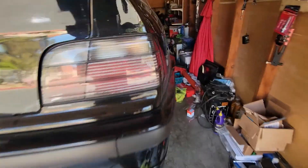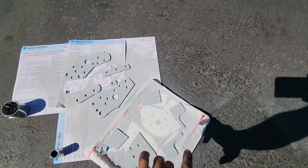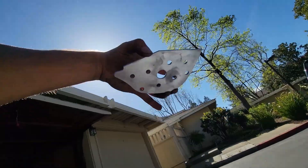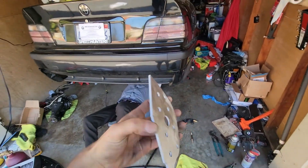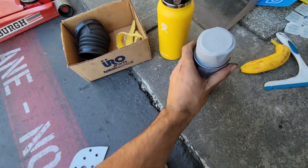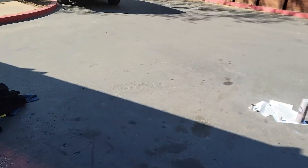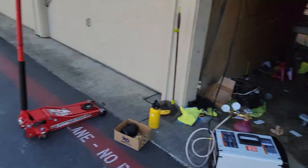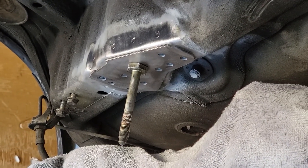Quick recap: I broke my phone but I prepped everything, primed everything, and now he's welding it. These are primered on the inner side, so the bottom is not primered so you can weld through it. Everything is stripped of paint and seam sealer so it's ready to be welded. The primer we're using is PBE weld-through primer. We went with new freshly tapped bigger holes and higher grade bolts — these are 10.9 grade from Fastenal, more durable than the OEM 8.8 grade. Shouldn't rust but we live in California so it should be fine. We're gonna seam seal on top with a brush.